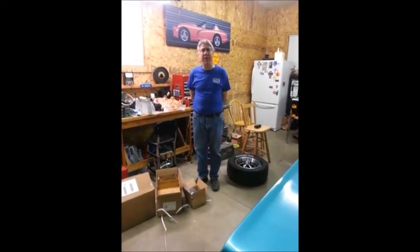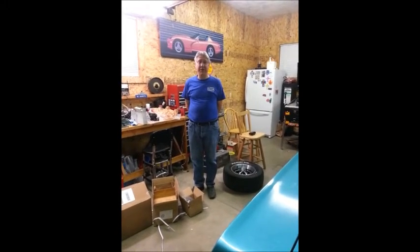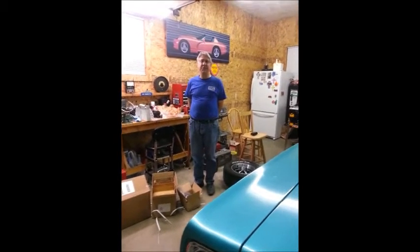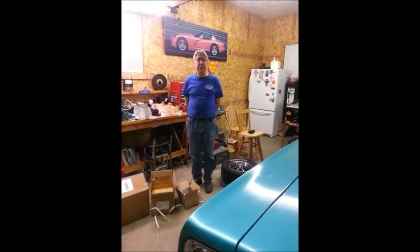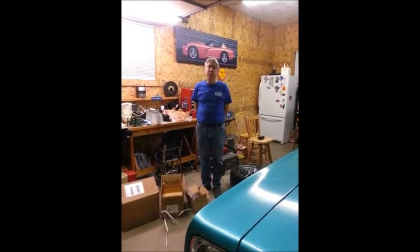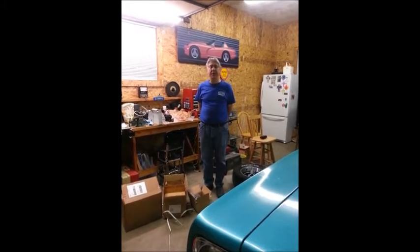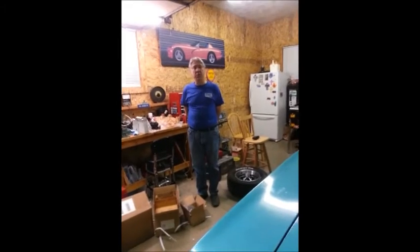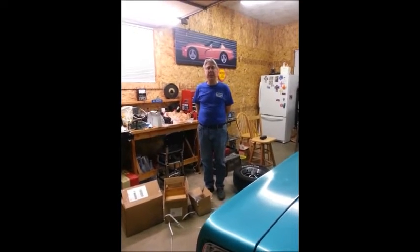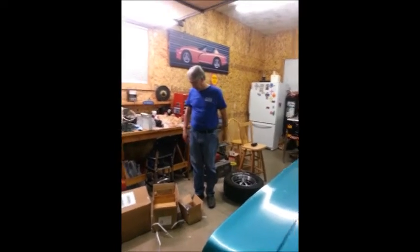Welcome back to Project BeepBeep on the Average Guy's Restoration blog. I'm sure you're tired of hearing me talk about brakes, and I'm tired of talking about brakes myself. In the last video, I was hopeful that the drums could be turned and I could go with a muscle car brake ceramic shoe solution. And my buddy that runs the local brake shop said no, the drums are out of tolerance. One drum was way out of tolerance to be turned. Another drum was not so far out of tolerance, but it had a bevel cut in it. And so that brought me to the decision to get the disc brakes.